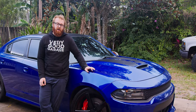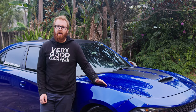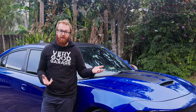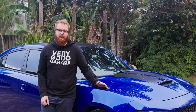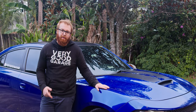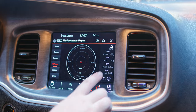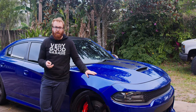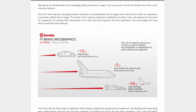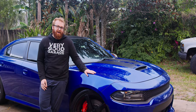On the track, when they're hot, these pads are incredible. My car records peak Gs when braking, and my highest score has been around 1G, which makes sense — that's about what a new BMW M3 should get, and these are some pretty aggressive six-piston Brembos. But with the track pads, after being hot, I got all the way up to 1.33 Gs, which is the same as a Veyron, according to this article from Brembo about braking forces in F1 races. And my Charger weighs 400 more pounds than a Veyron.